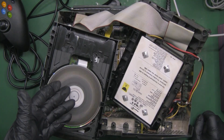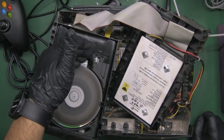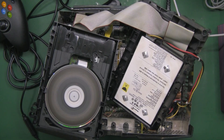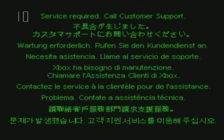If you take a look here it looks like the disk wants to read — the laser's right there, it's detecting it and then it goes back. It's still trying, spinning up really fast. It looks like it's stopping. The console is throwing error 10, so this is definitely the first time I've seen error 10.